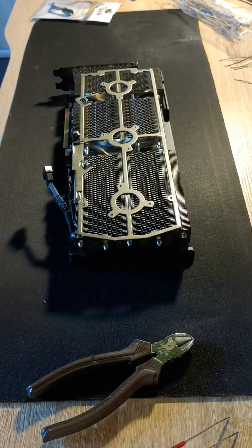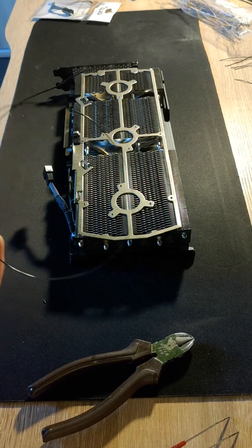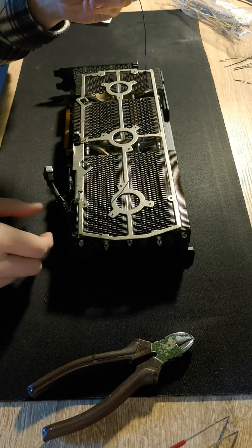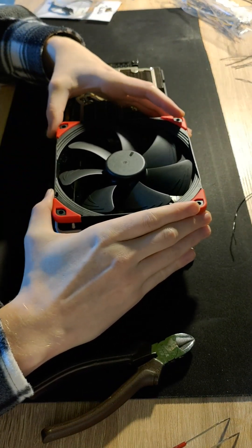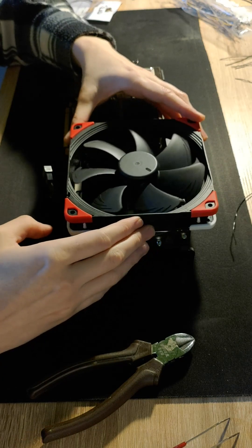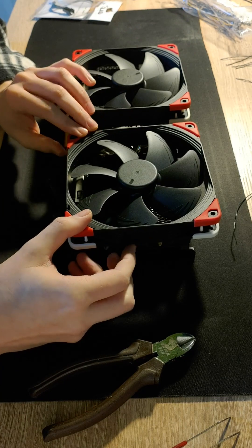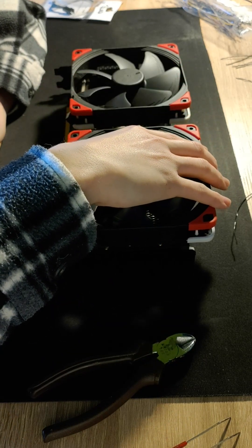For proper wire to hold your fans, you have to check the distance between the heatsink fins to get the proper diameter of wire. I got mine measured before on the Phanteks fan. The wire needs to be easy to get between the heatsink fins. Start with planning the position of your fans. Make sure to align it with the bottom line of the heatsink next to the PCI slot, with the plug not facing the visible area. Fans don't need to be perfectly flat in line — you have to adapt to the wiring handles on the heatsink.